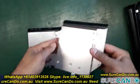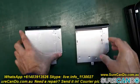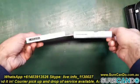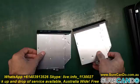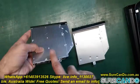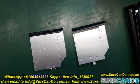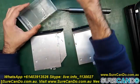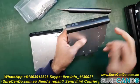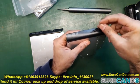Here is a quick video on DVD drives for laptops. They all look different to each other, but actually they only come in very limited styles. The heads and the rear connectors are what's actually different — apart from that they're all pretty much the same. The main thing to factor in when you buy one is the thickness: they come in a slimmer model and also the standard size. Some also have a different tray ejecting style — the slot style where it sucks in the CD or DVD, and others where the tray comes out.